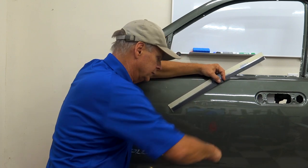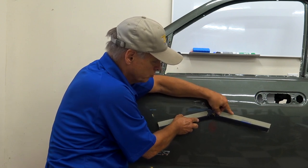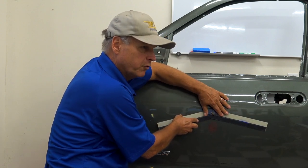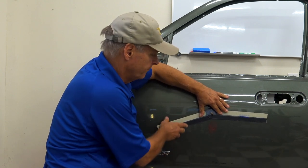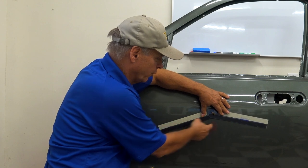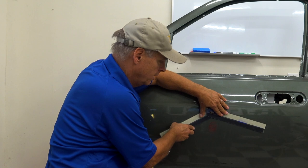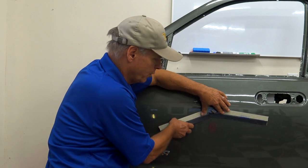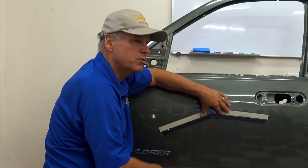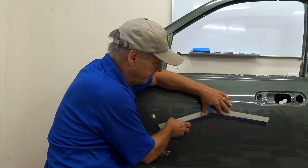Now, we hit this a little bit harder than that, and now it gets hit hard enough to where the crown reaches what we call the breakover point. Have you ever heard that term in auto body? Well, a set point, but yeah, breakover point, I've heard. Breakover point is that point where when the crown forms from there or steeper, it's there for good until you get rid of it. So if we get hit hard enough, and usually the breakover point on most crowns is right around 150, 160, depending on the curve of the panel and a lot of things.